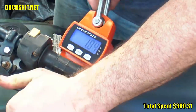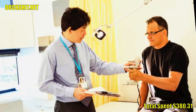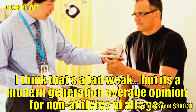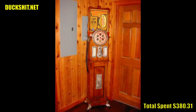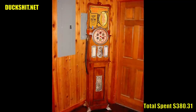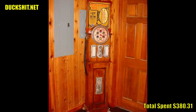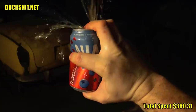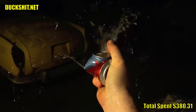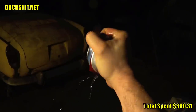Before my next test ride, I wanted to demonstrate just how hard it is to pull my clutch, so I got out my crane scale and found it varied a bit but required about 70 to 85 pounds of squeezing force. A sports medicine doctor friend of mine said that 70 to 75 pounds of grip force is normal among most men. I had a flashback to my childhood when my father tested his grip strength on a carnival machine — he came in at around 125 pounds. Everyone else in the family were women and children at 50 pounds or less, except me. At 12 years old I squeezed a 112, with my left hand. What I'm getting at is the clutch is incredibly hard to squeeze — still just barely manageable for me, let alone anyone else. After a couple dozen good pulls in succession, I get so fatigued that I have trouble pulling it far enough to fully disengage the clutch. It's just not fun.